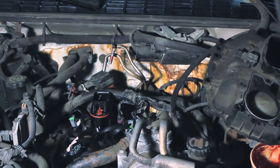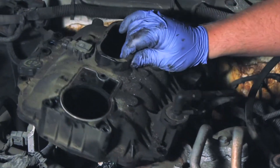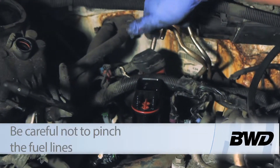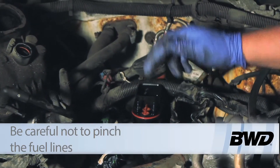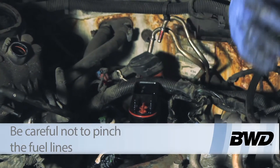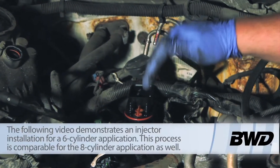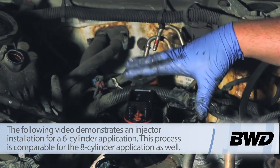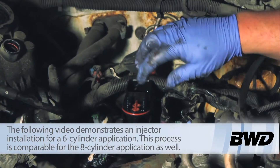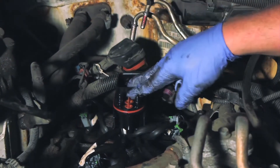Once they're all locked in place, we're all set to install the upper plenum and complete the job. We've done a good job lubricating and installing it properly. Now we can install the upper cover, remove the two little plugs, and slide in the lubricated fuel lines. We'll finish installing the throttle body, cables, and plug everything back in — the vehicle should be ready to go. Don't forget to clean it, don't forget to lubricate it, and be gentle when installing. Thanks for watching and enjoy your new fuel injector.